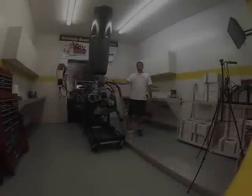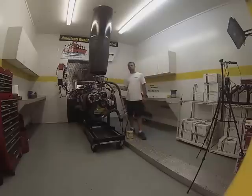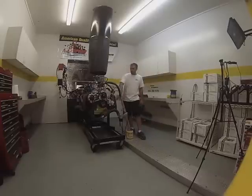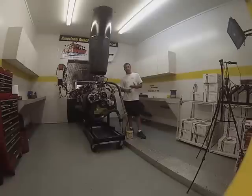Okay, what we have here is pretty special for us here at Prestige. This is an all aluminum based 363 cubic inch small block Ford. We start life basically with a Carroll Shelby all aluminum block. That's going to be a 4.125 bore. This particular setup gets a 3.4 inch stroke, 5.4 rod, and a really nice custom forged piston.